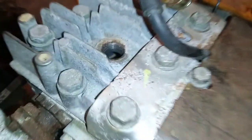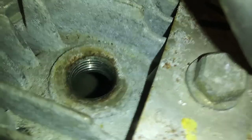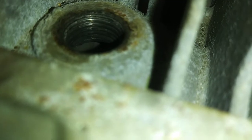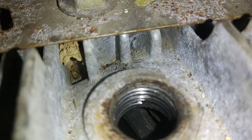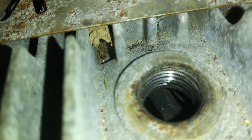Looking in through the spark plug hole, when I'm pulling the recoil starter you can see the piston going up and down. We can see that valve going up and down — that valve is the exhaust valve. Just on the other side of that valve is the muffler. Now looking toward the carburetor side to see if the intake valve is moving — there's the lip of the valve, we can just see it. We can see the piston going up and down, but the intake valve is stuck open. That's why we're not getting any compression.